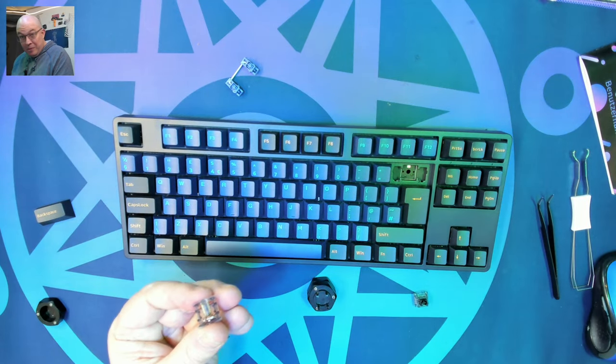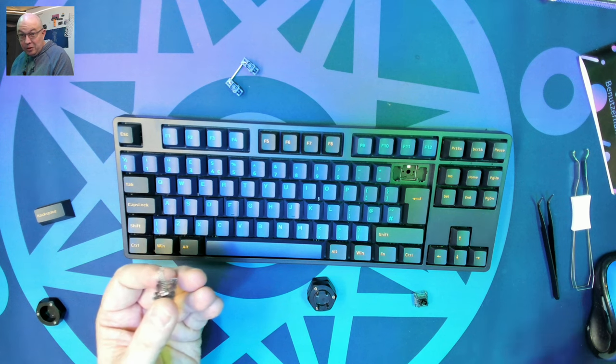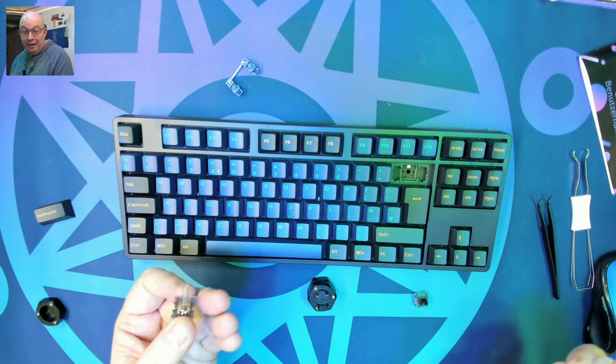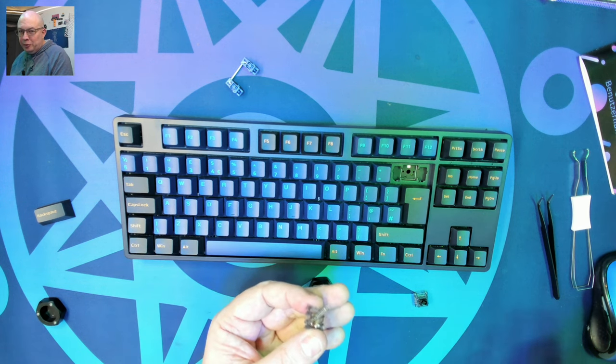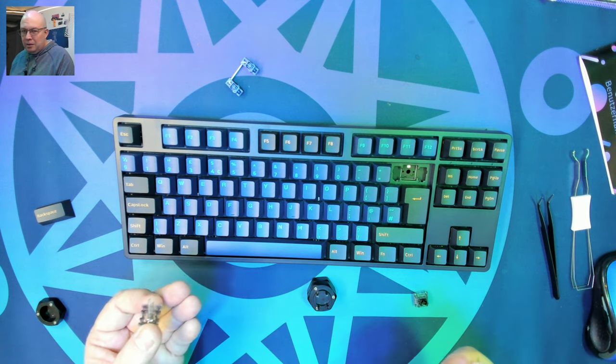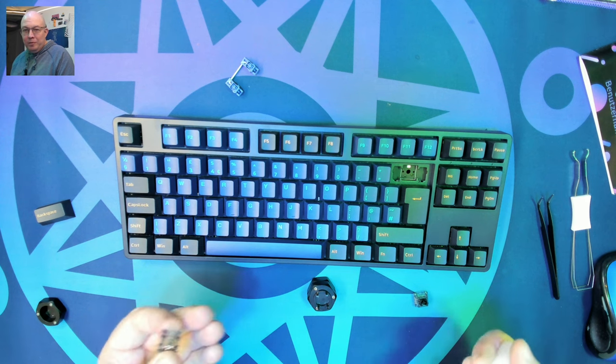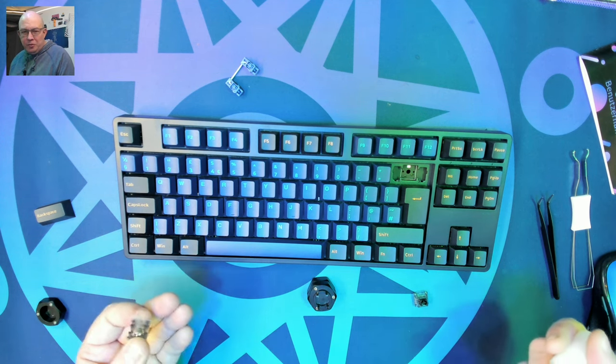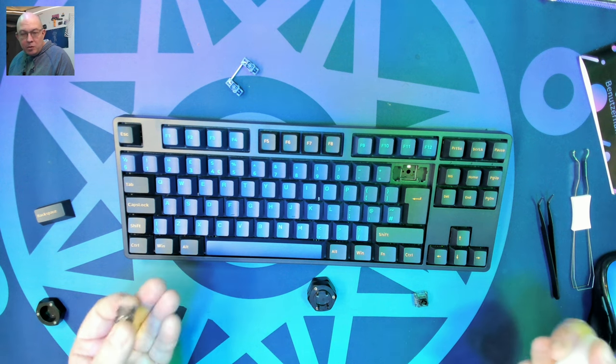Well, it's metal and it can reverberate, so it's part of what makes the sound. In some switches that have had the spring lubed, but the leaf spring not lubed, that's where the ping is coming from. So if you're ever like, man, I've lubed these switches, but they're still pinging, what's going on?